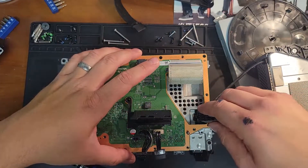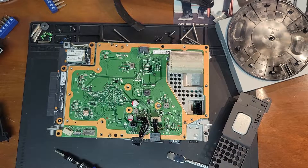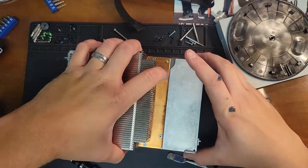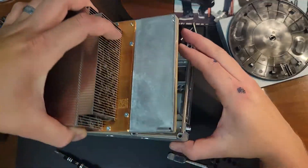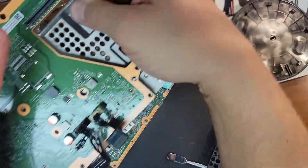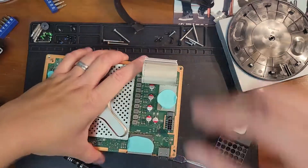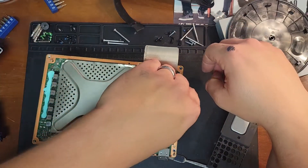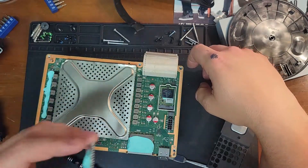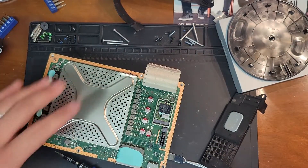Take all the shielding screws out. Once you get it all apart it's covering your entire workbench and you're partially overwhelmed wondering if you can put it back together — but it'll be okay. With the shielding off, there's another hidden screw holding the power supply on. Take that out, open this little clamp, lift this up and fold that back for now. Unplug this little ribbon cable, unplug the power supply, flip this over, lift this off, and feed that big ribbon cable through the slot. Now we're finally down to it — right here is the M.2 SSD.